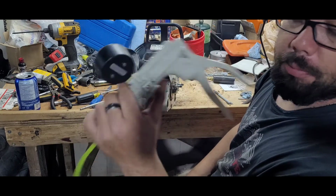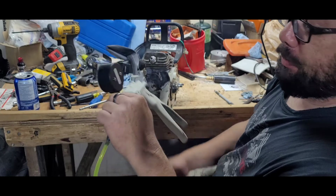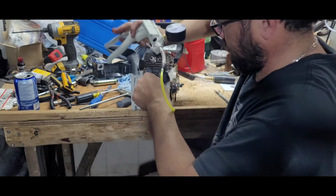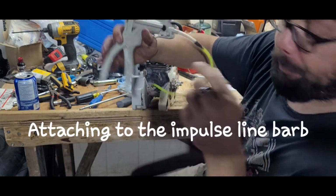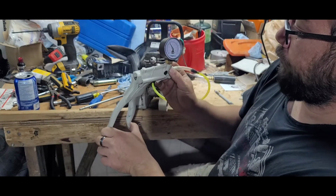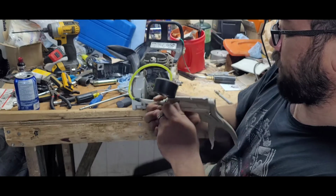This is a Mighty Vac pressure vacuum pump. I bought it for doing chainsaws, but I also bought it for setting the turbo up on my Can-Am X3. So, start with vacuum here first. And by the way, if you're testing for seals or vacuum leaks, you need to do it properly, you need the vacuum and pressure tester. So, go down to 10 pounds of vacuum. Okay, just set it for vacuum.